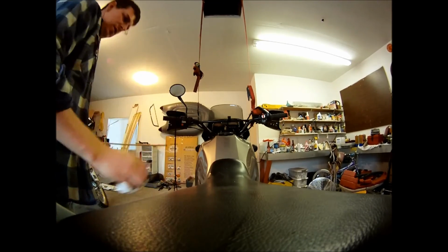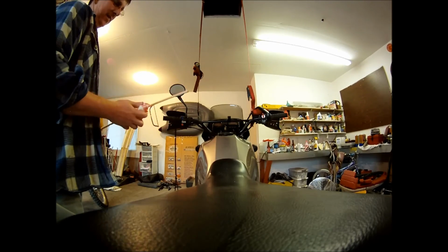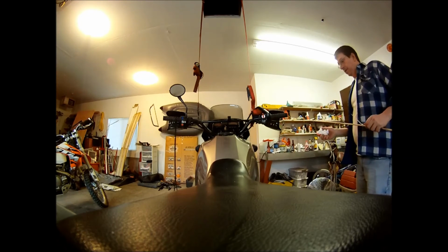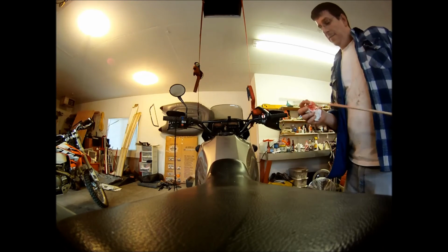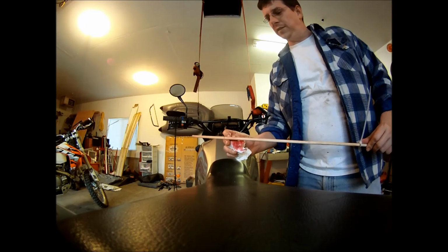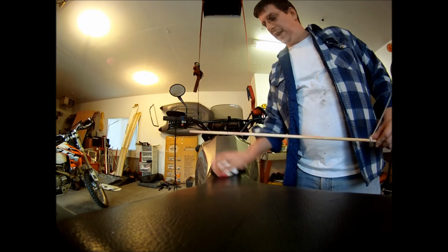Some of the stuff I've been doing has been bigger drops, and I've been bottoming out a little bit, and some of the riding that I've been doing in the desert really whooped out with big whoops. And I want it to be a little stiffer, and we'll see. So there's a fine line between this line and that line. There must be something that takes up a lot of space, because it only takes like 30 milliliters to bring it up an inch and a half on the stick.